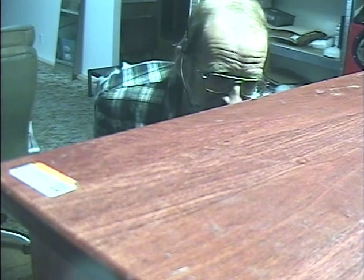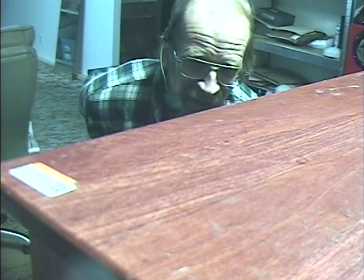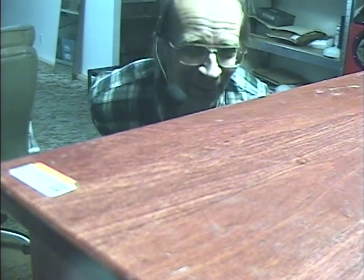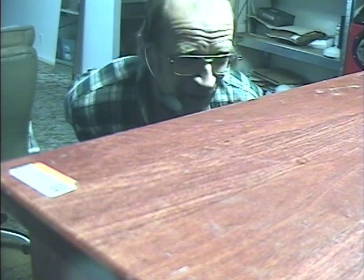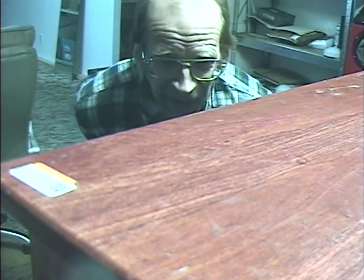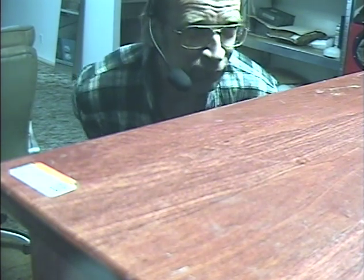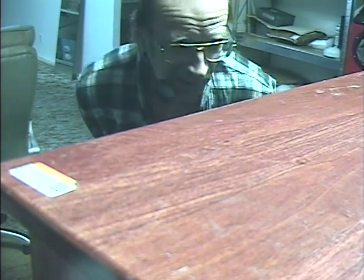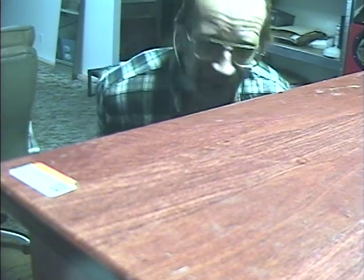Just as a side note, you hobbyists out there who are saying, "Well, wait a minute, you made your calculation based on DC theory." I am aware of that, and we went with the 20 amp switch, which gives us an extra 7.5 amps of safety margin for the possible 50th of an amp I may be off by using DC theory for my calculation.